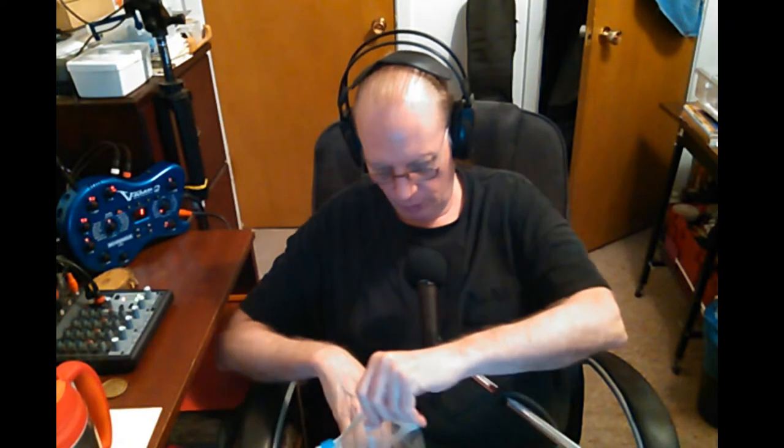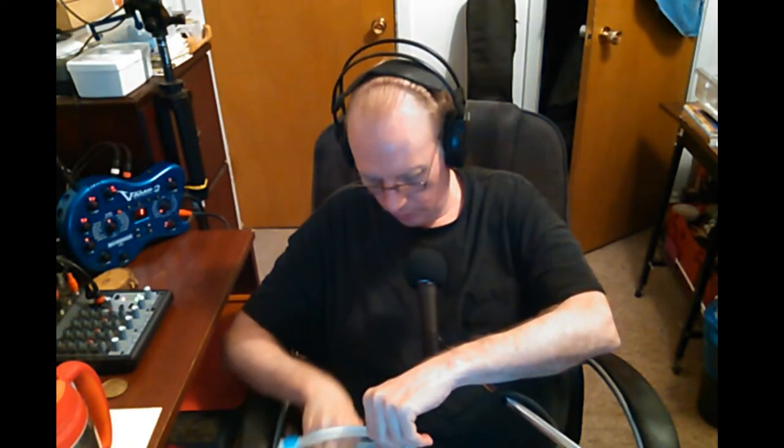I think I tried it anyway just to see if it would pick up the signal. But phones are completely different. Their 3.5 millimeter female connectors are made for input and output, you know, mic in and earphones out. So that's why they're TRRS. So I might have something that goes from big to little or little to big, but I don't have anything that's a TRRS. Yeah, there's one right there.